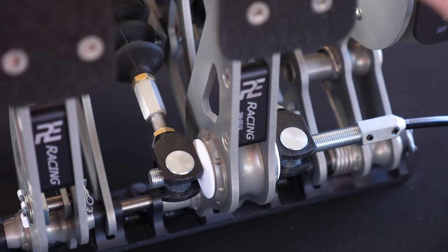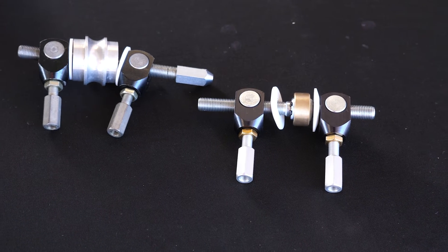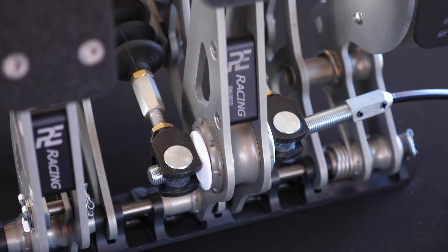Some coarse adjustment in the brake bias can be made by selecting the size of the front master cylinder versus the rear. But even once this is done, some adjustment to that brake bias may be needed while the car's out on the track. Adjusting the bias is achieved via an adjustment knob located somewhere within reach of the driver, normally on the dash or on the roll cage. This runs down to the pedal box and via a screwed adjuster, moves a spherical bearing within the brake pedal. Depending on where that spherical bearing is located within the brake pedal, we'll adjust the force distribution between the front and the rear master cylinder.